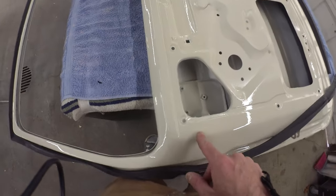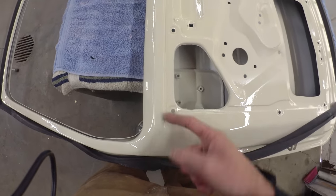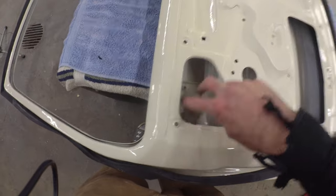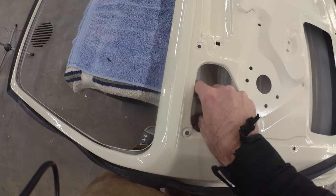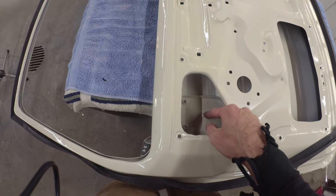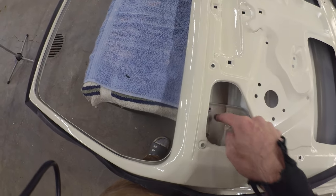I think it's this one - you can almost see it there that this nut is lower than this nut compared to this line. Basically they twisted it. The question is, if you pop these three captives off, can you rotate within those holes enough that you can get it square again? Because the holes are like an M6 but they drilled like probably a 10, so you got a little bit of slop there to work with.